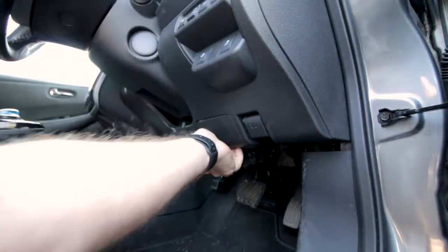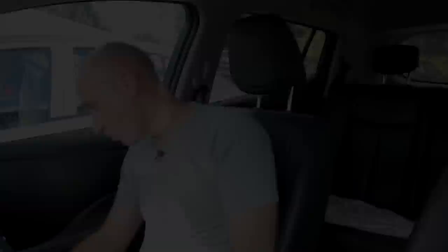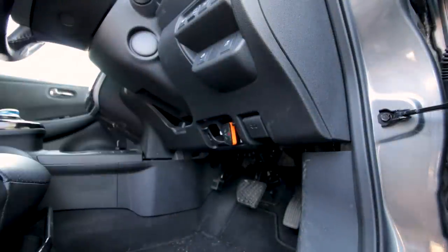So here we are in the car. Hopefully at this point you have downloaded LeafSpy onto your phone or tablet, and you've got your OBD2 all ready to go. The first thing we need to do is get this plugged into the car. In the Nissan Leaf, if you look down by your right knee, there's a little panel that you can remove - it has two tabs at the top that clip in, so pull from the bottom. Behind there you should find a little plug. If you look at your OBD2, you'll see it goes in one way and one way only - just plug it in there, then turn the car on. You should see a little red light on it just to show it's connected and there's power going to it.